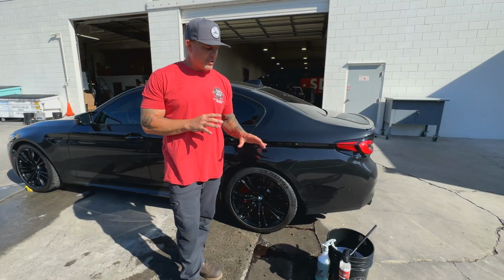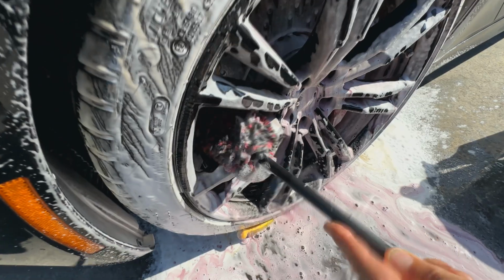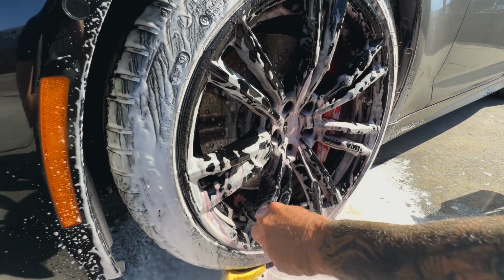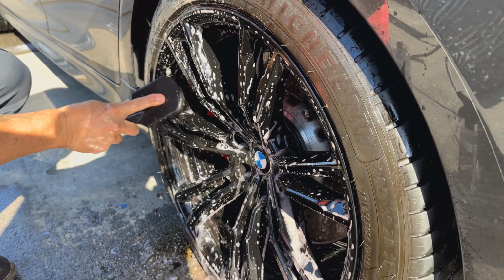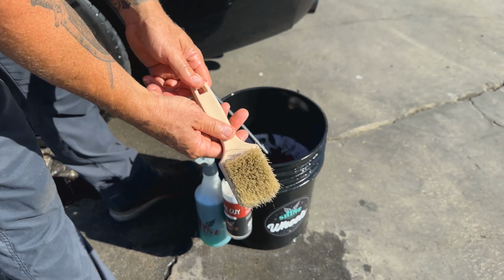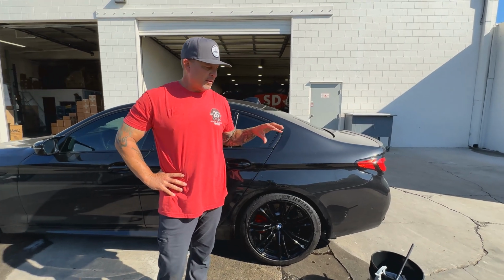All right, another thing is when you're using the Cool Guy wheel cleaner, as you saw, I was using some of the wheel Woolie brushes. That allows you to use less product, and you're gonna use your brushes to agitate and work the product so you don't have to lean so much on the product's performance, because the brushes help do some of the cleaning for you. So make sure you have a quality set of brushes, and the stiffer brush, we'll have it in the description below, is our multi-purpose brush. That's great for scrubbing tires. You just always wanna make sure you stay away from the rim surface when you're using that brush because it is a stiffer brush.